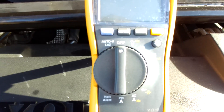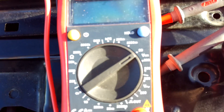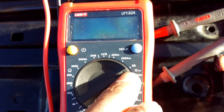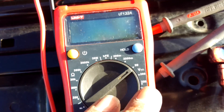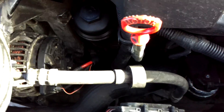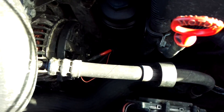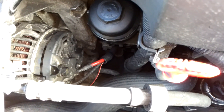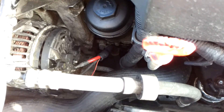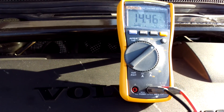I'm going to be using my Fluke multimeter, but you can do these tests using a simple multimeter — you don't have to have anything fancy. You'd have your multimeter set up with black in the COM socket, red in the voltage socket, and have it on the 20 setting on DC volts using a manual range meter. I'm going to connect the red multimeter lead on the alternator output post, the black lead on the alternator casing, get the engine running, and see exactly what the voltage is.